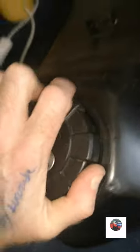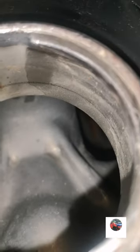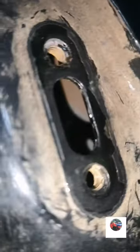There's the tank to go on it. And it does look like it's just been cleaned inside. So I was going to put an inline filter on the petrol pipe, but it looks alright. But there, looking down there on the right, it looks a bit rusty. So I might put an inline filter in it. I'll just have a check through there, see if we can see anything. See, look, you can see rust there. So I'll put an inline filter in as well.